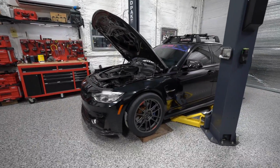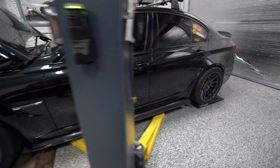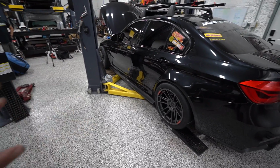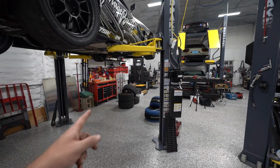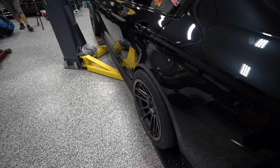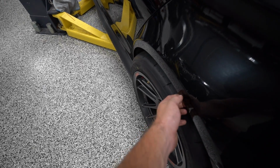All right, well, the wheels look absolutely incredible on here. However, I made a miscalculation. My old wheels, I thought were 25 offset. These are 23 offset. So I thought we were good. They're not. They're 33 offset. I just remembered incorrectly. These are 23 offset. So they are more aggressive and they poke. Wouldn't be a huge problem if this wasn't a drift car.